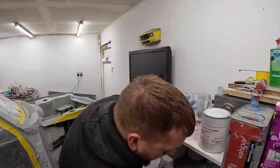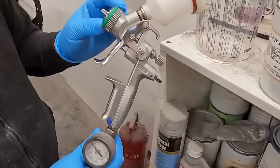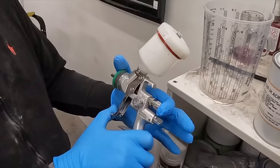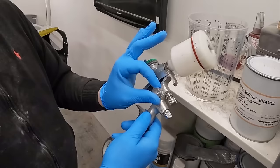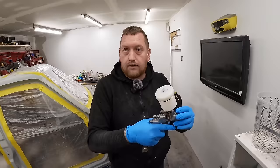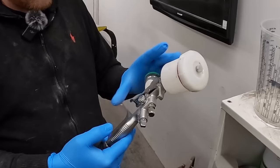You're going to be using a different gun today, yeah? So today I'm going to be using my Sata mini jet, and this is a 1.3 fluid tip. We're going to go at two bar pressure. I've got a full fan — on the Sata it sits here — so that's fully open, nice and wide. When it comes to the engine bay, it's easier to get into tight spaces with this rather than a big gun, and I want to get a nice finish on this, so I've decided to use this one.